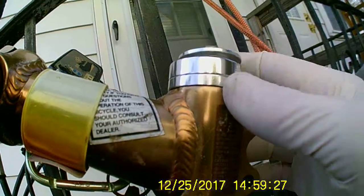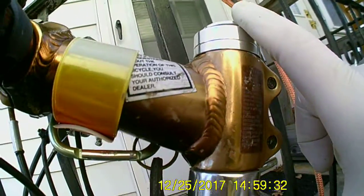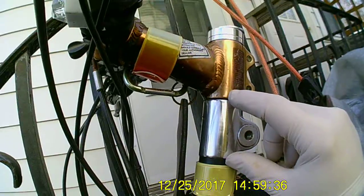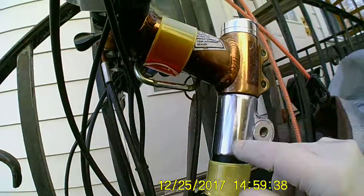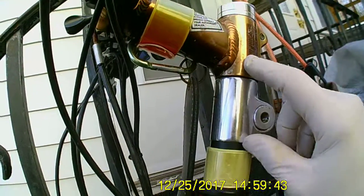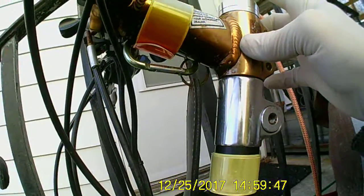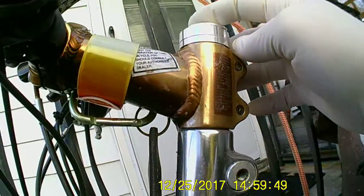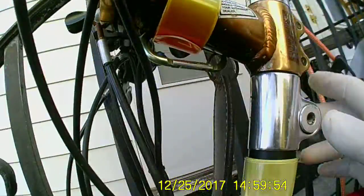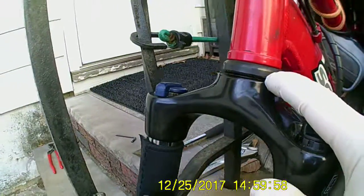The two on top go with the cap, and this long bolt, it's about that long, and it's only got that much threads on it, so you got to make sure that star nut is hammered down in there just enough where you're catching all those threads. So what I do is I thread it down in there, make sure everything is all straight. I got the dust cap.